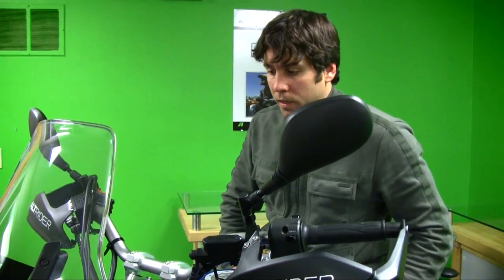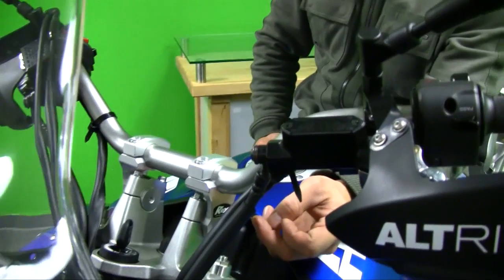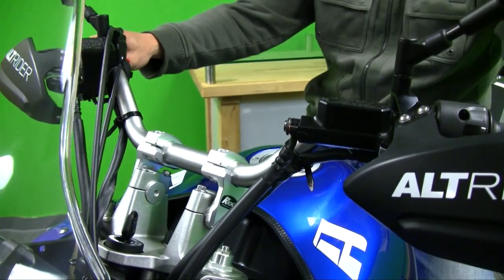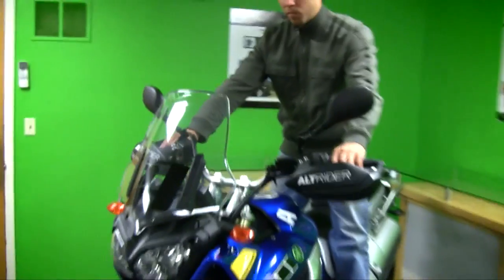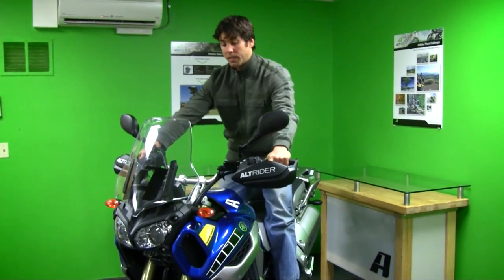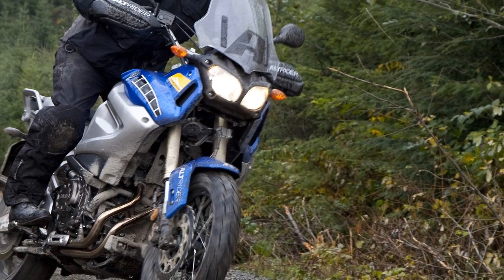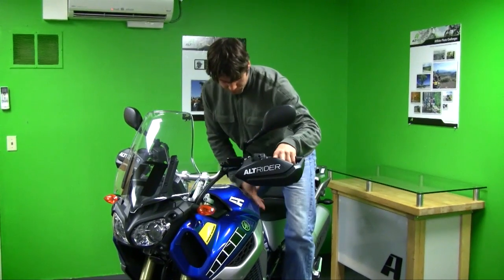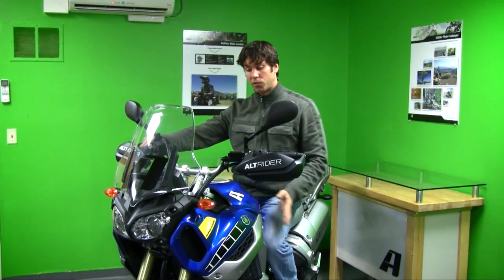It's a really nice product — comes in anodized aluminum. The central mounting position allows adjustment so that if you're a shorter guy with shorter arms, you'll probably want more rake. You're still getting the rise that helps in the standing riding position. Bar risers become pretty important for the off-road rider so he can get into a standing position. The whole reason we stand is to be more responsive to what the bike is doing — you get a little room of insurance to let the bike move.